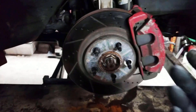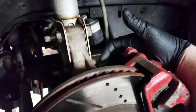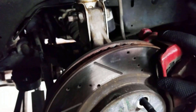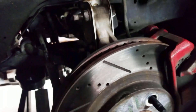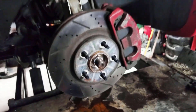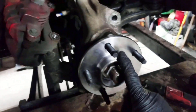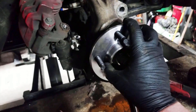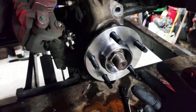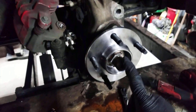This is really easy if you're getting ready to do this upgrade yourself. There are two 15mm bolts on the back that hold the caliper bridge to the spindle. We're going to take those out, pop this up, and hang it for right now, and then we'll look at this and see what's going on. With all that off, you can see I also just changed this wheel bearing. I'm not going to cover that in this video because I already did a video on that, but I will link that in the cards and down in the description if you want to check that out.